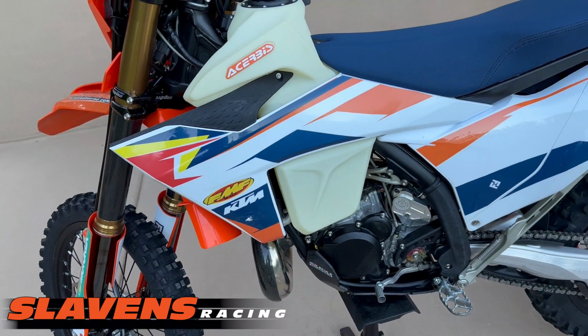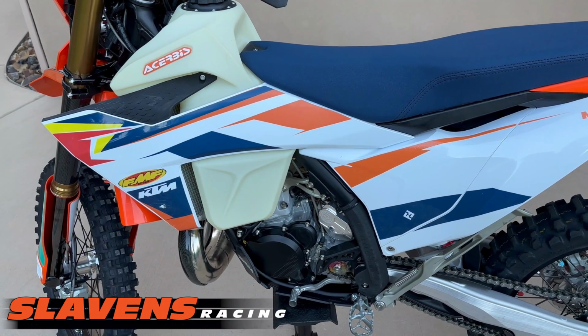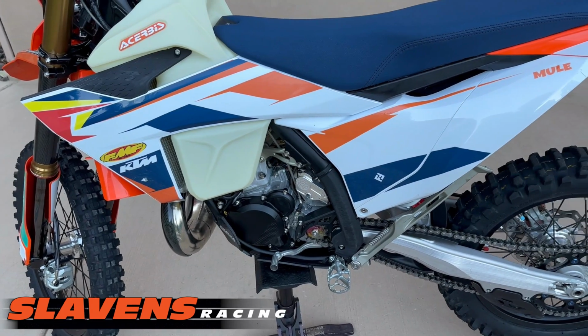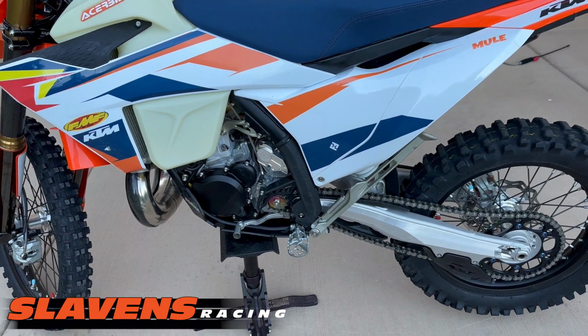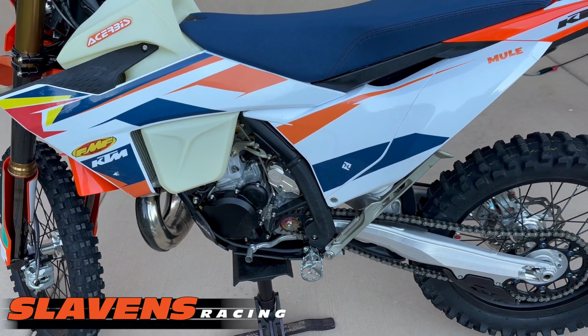Oh, on the other side also is a fan kit, a Trailtech fan kit. And I set that at 190 degrees. Guys ask me that quite often. It's set at 190. And for any type of tight trail work, if you're having a problem with your bike boiling over, buy a fan kit. We've got lots of other little widgets that help some, but if you want to resolve the issue, buy a fan kit.